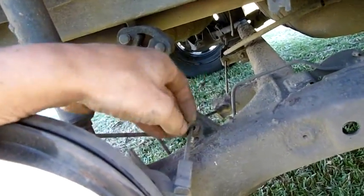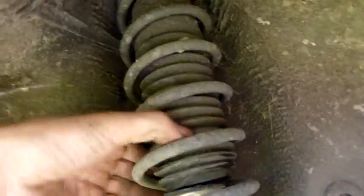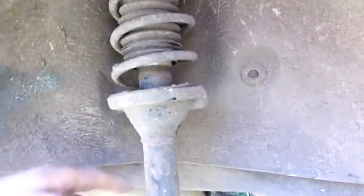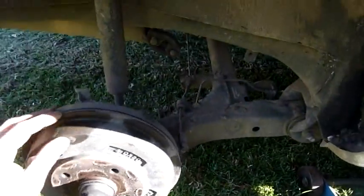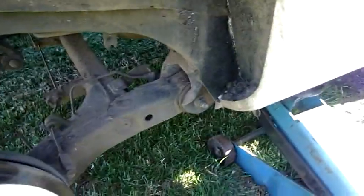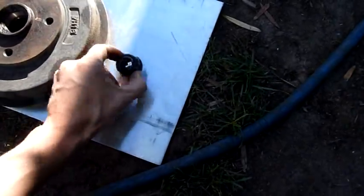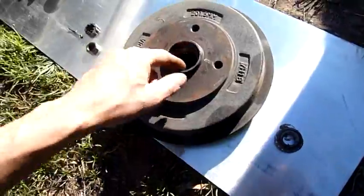That boot's broken there - that's just keeping dust out of the cable assembly. The strut shaft looks all right. If you see oil coming off these it means the main seal has leaked. The hub came off surprisingly easy - literally just fell off. The main outer bearing race - the grease is very black and nasty. It hasn't had new bearings for a long time.